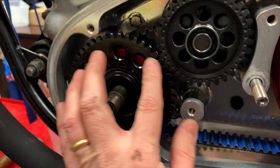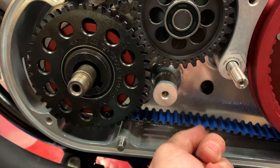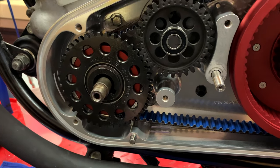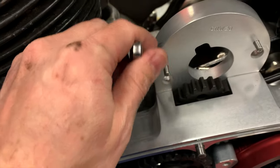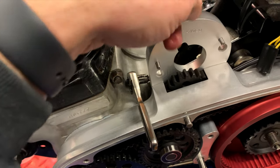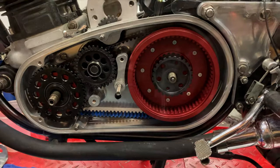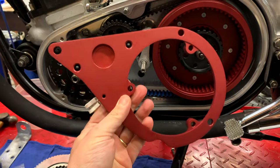That's on a little bit better and I'm pretty happy with that. The tension is pretty close - I'll obviously check it again once I'm done. This is the one I'm using to bring it forward, so as I tighten this front nut it brings the whole gearbox forward, and then it's just a matter of cinching all of the other adjusters down and then tightening the fixing bolts.